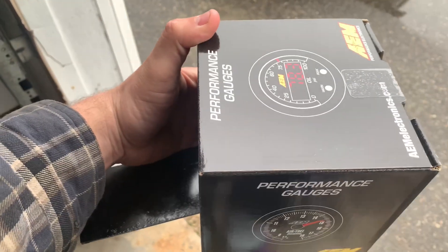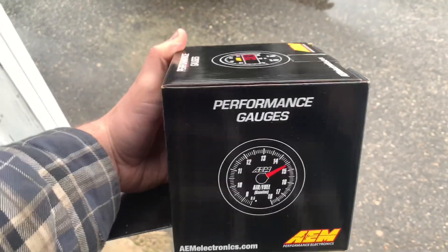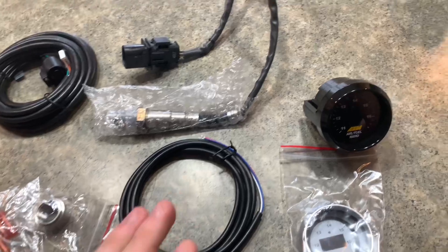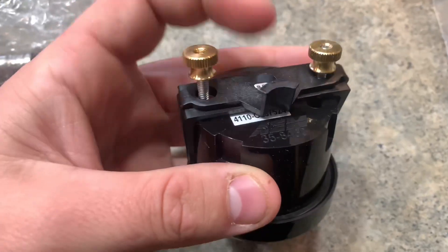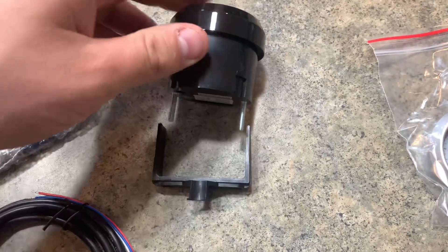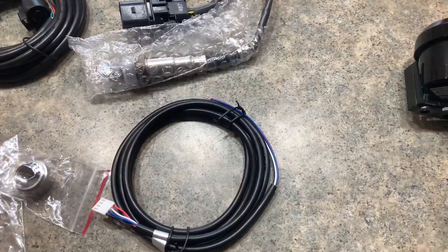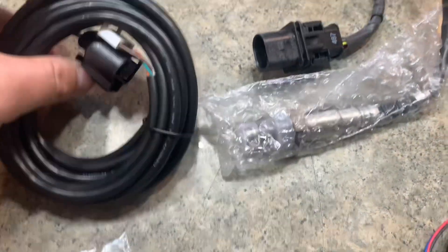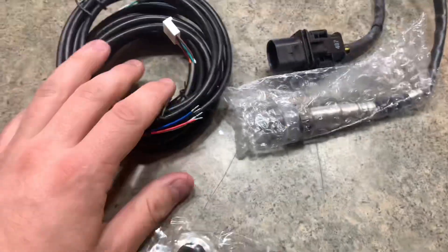Really quick — I don't think there could have been more perfect timing. This is literally the wideband gauge we were waiting on. Now it's going to get a little serious. I'm going to try to get this done over the weekend. Okay, so to break this down: we just got our AEM wideband gauge in. Right here is our gauge — it's digital. This is the white face plate if you want that. Right back here are the little brackets you use to hold the gauge into place. You slide it into the hole and this will go around these two prongs and hold the gauge in place on our custom plate that we are currently making. Right here is the power harness — that's going to plug right back into the gauge. And over here is the O2 sensor harness — this also plugs into the back of the gauge. You can't mess that up; it's pretty easy. When we're out there, I'll show you what wires run where.